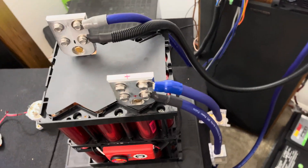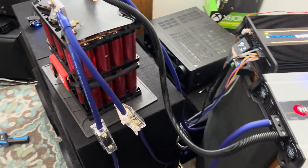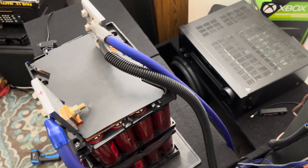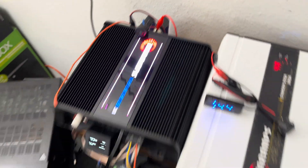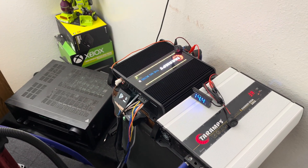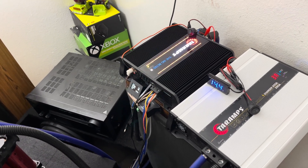Recharge is really fast — that's good — but why? So now I'm thinking my wires are holding me back. Is my wire just not big enough? I mean, zero gauge OFC — am I gonna need two runs? At least that's a little more doable with these. I just have to get some different reducers, because the terminals already don't fit just the zero gauge. Two runs — I'm gonna need some very specific reducers, or a two-into-one and then a reducer down to the small size.